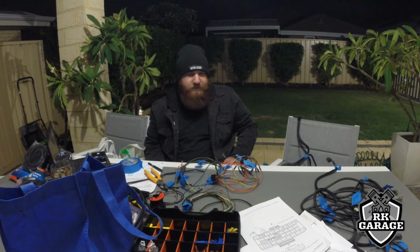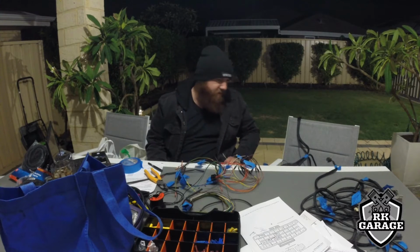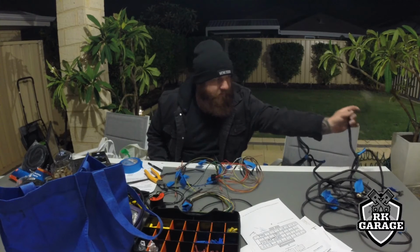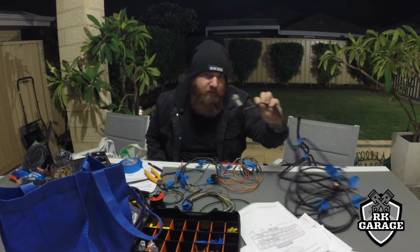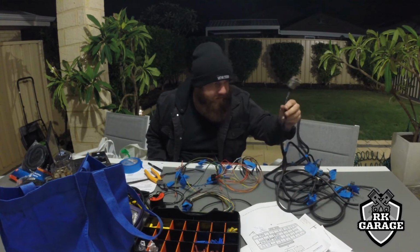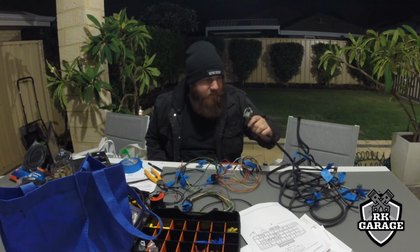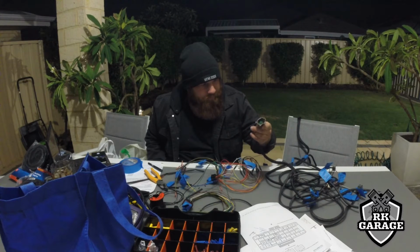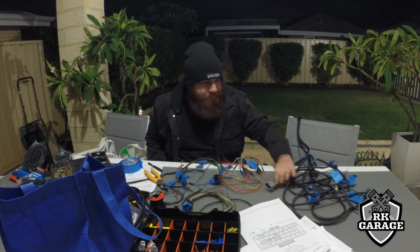I've got to either buy plugs and rewire it in for LS1 coils, or buy IGN1As and change plugs to them, or LS2, so I might as well just wire them in. They're on a breakout harness anyway, it's got to do each plug on there that connects in the engine bay, so I can at least get it out to the engine bay here, and yeah, we'll see how it goes.